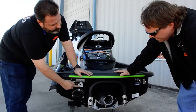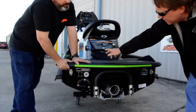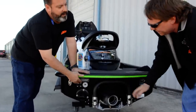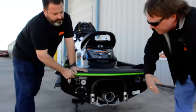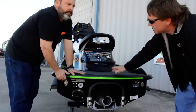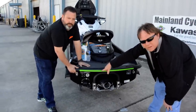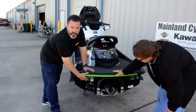The gray connection is for your intercooler. You want to flush your intercooler out — you can use Salt-A-Way for that too. Do you run the motor when you do that one? Do not run the motor. It'll go through the system and flush it out. We had a gentleman who was overheating his motor and couldn't understand why. He wasn't getting any water through his cooling system, only through his intercooler. So when you're flushing your intercooler, do not run the motor, because you will overheat the motor.